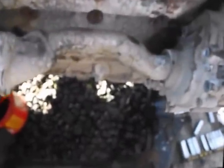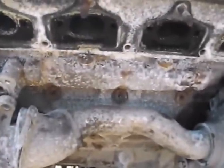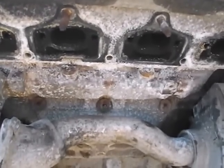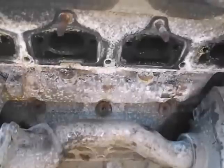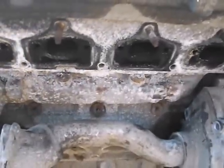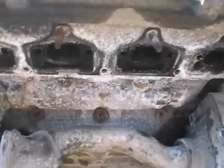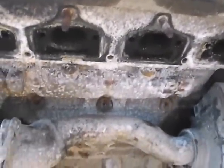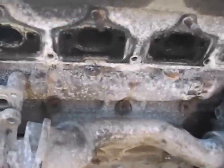This is where the fun starts. It's a lot easier to remove the exhaust manifold, but I suppose it's manageable without removing it — very difficult with the exhaust manifold in place. I'd recommend removing the exhaust manifold; it's not very difficult. This way you can replace the exhaust manifold gasket and assure yourself you have no exhaust leak.